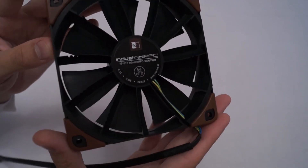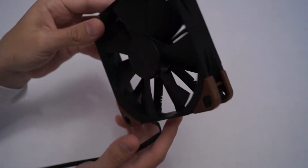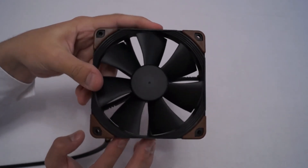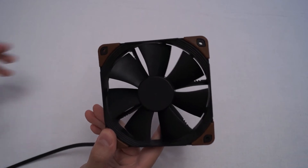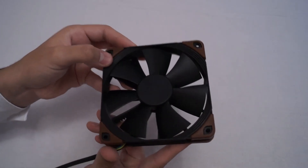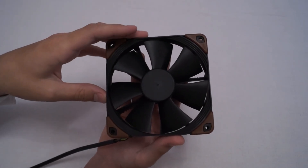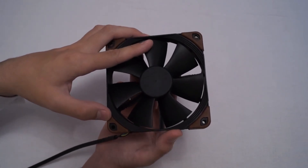We also have a completely new plastic that it's made of. All Noctua fans are fiberglass reinforced on the entire chassis, the fan blades and everything. But on the original designs, what you get is fiberglass reinforced PBT — polybutylene terephthalate. Whereas these ones are fiberglass reinforced polyamide, which is meant to be a lot stronger than the original design, and they claim it can withstand up to 140 degrees Celsius.